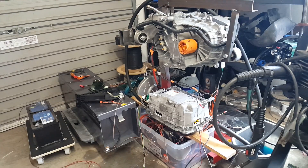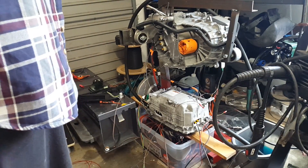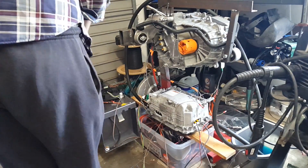Hello folks and welcome to your next Model 3 drive unit FOC update. We just made some progress so I thought I would shoot a quick video. Welcome also to the craziest testing setup I think I have ever done. Without further ado, I'm going to connect the oil pump to this 12 volt battery here. The first sound you're going to hear is going to be the electric oil pump — the 12 volt electric pump in the drive unit — spinning up.